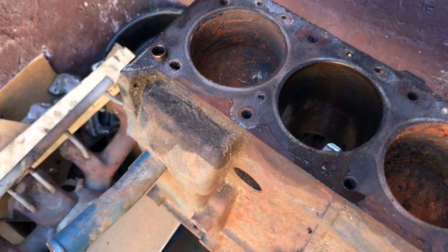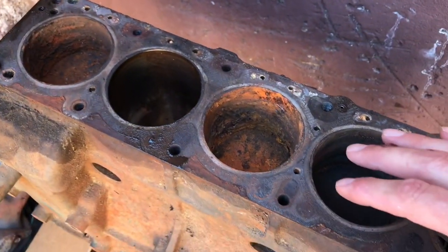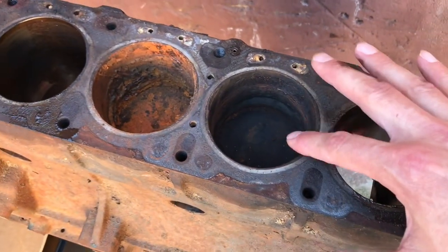What we're going to do is head out to the block that's outside and let it soak to see how it does. One thing to be aware of: this is not safe on magnesium, so if there is magnesium in the pistons it will destroy them. In our case, we're getting rid of the pistons anyway, so we don't really care. We just need to get those pistons out. You can see the piston is rusted and the sleeve as well — this one's pretty bad, this one is stuck.